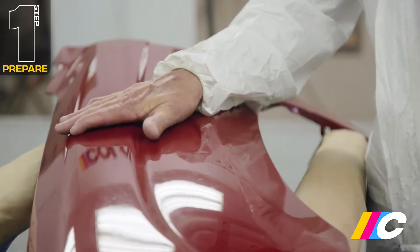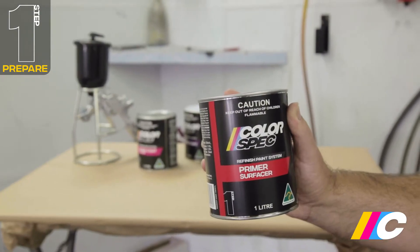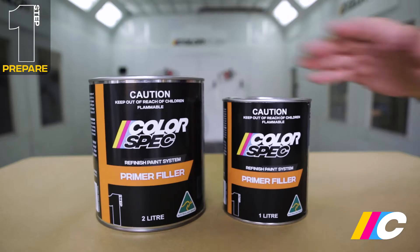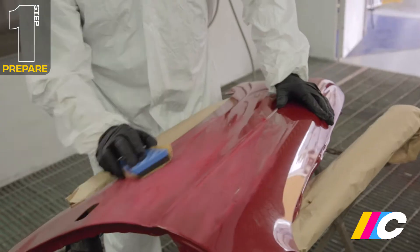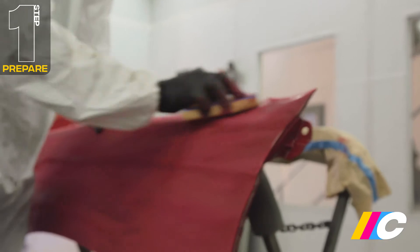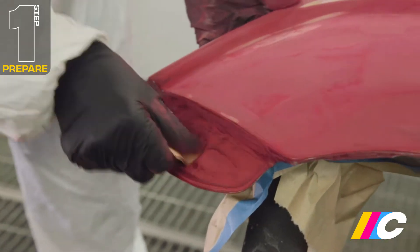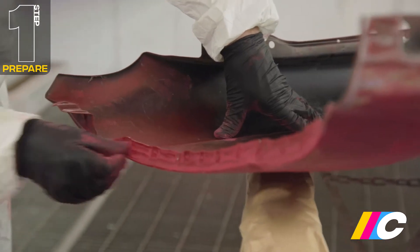This replacement guard was in good condition. It didn't need any repairs, so we'll start with Primer Surfacer. If you're painting over a pitted area, our Primer Filler is the better option. To get proper adhesion, you need to thoroughly scuff the existing paint with 320 grit sandpaper. Be thorough, as you'll have poor adhesion on any areas that you haven't sanded.